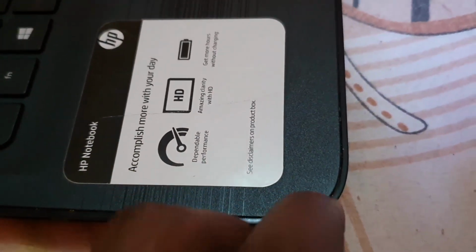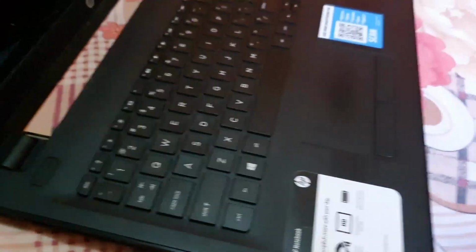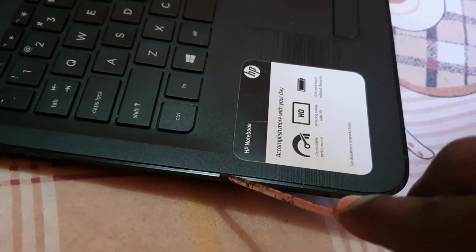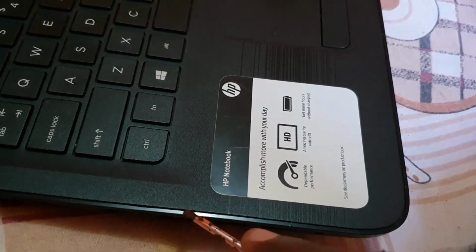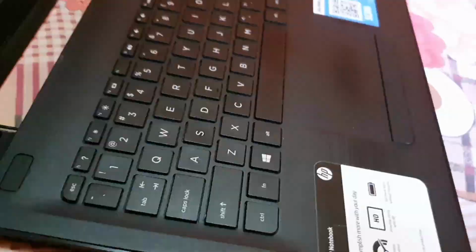Usually the seams are along here to open. However, if you do not see those, you have to check along this side here, and here's the groove, and this is where it's going to open from. All right, so we're going to start opening, going around. Usually you need some form of tool to open up. I usually use a screwdriver or something. Not the best tool to use, but just be careful, as it does smudge or mess with the plastic a bit. But if you can get into the groove right here, it should lift.